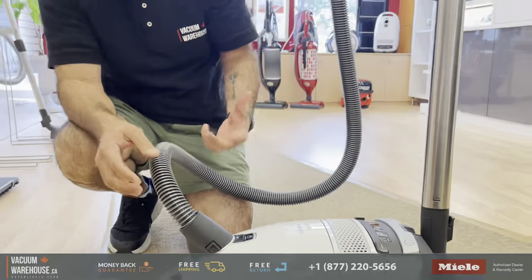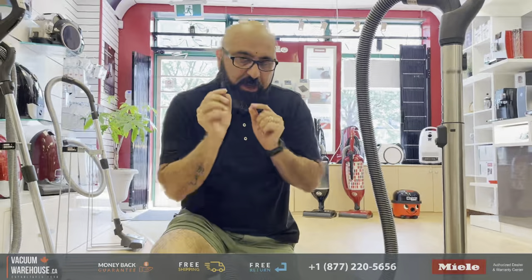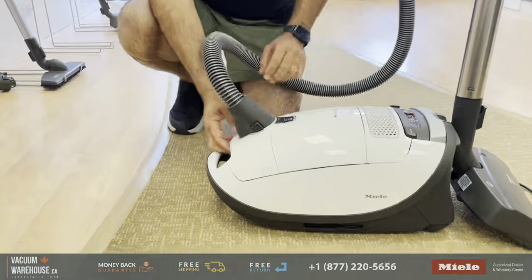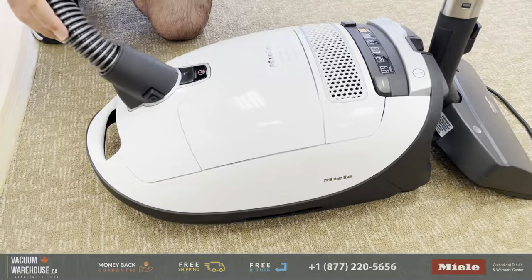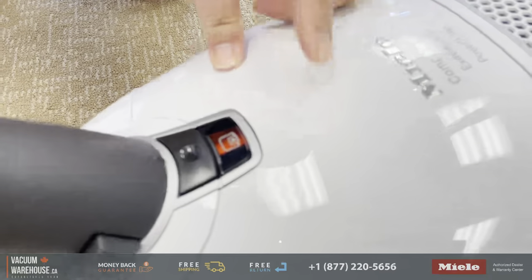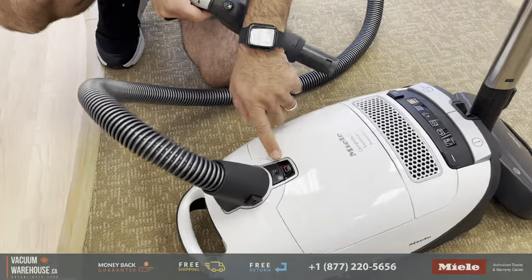As the airflow is obstructed, that orange bar — which is spring-loaded — will go across that little window. It could be an indication of a couple of different things. First things first, come over and I'll show you. If I turn the vacuum on, by the way we have almost a brand new bag that's empty. So assume you have a brand new bag in there. When I turn the vacuum on, that orange indicator comes out just a little bit. Watch what happens — it's on high suction, empty bag — and watch that bag full indicator. Right now it's on low.